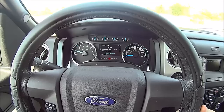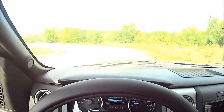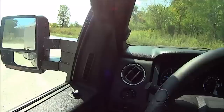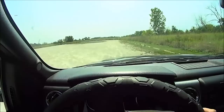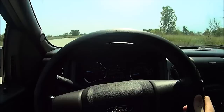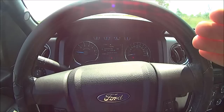For this test, we're going to start rolling to about 15 miles an hour, then squeeze the trailer brake controller. You can see we're not stopping at gain=1. We circle back to another straight flat section — we're on gravel but it's flat. You don't want to be on a super hilly surface; you want to be able to just roll. We're on a flat surface, so let's try again — and we know gain=1 is not going to do anything.